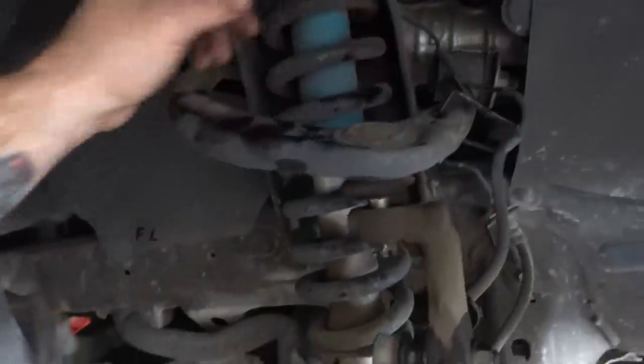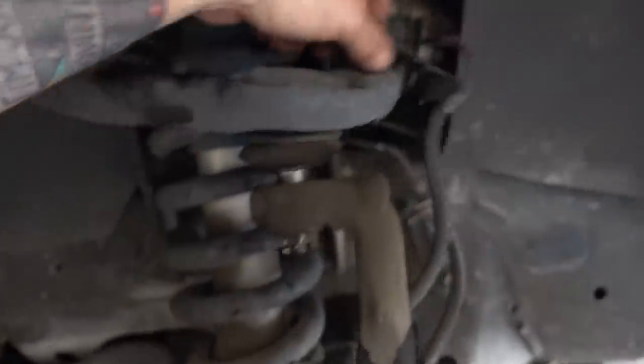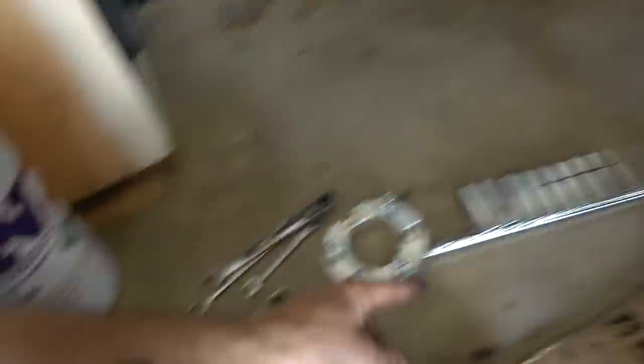It's hard to see a little bit in here, but let me walk you through what I just did. A couple of things that had to be done were to loosen up the upper control arm — pop that ball joint out; it's just sitting on a few threads right now so it won't fall out. I loosened up this brake line to give it some room to play with when it drops down. Then the tie rod is also loose in there so this can come out. Sway bar is disconnected. And then this bottom bolt is now loose. So what I'm going to do is pop these three off on top, first support it with a jack, pop these three out, pop that bolt on the bottom, and hopefully that'll give me access to get this out, put that spacer on, and then all we got to do is put it back together and repeat on the other side.